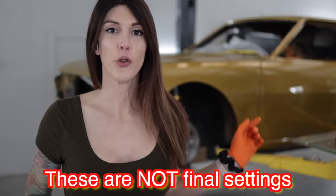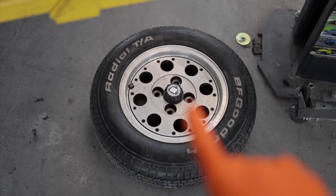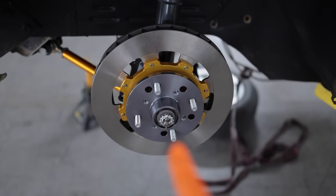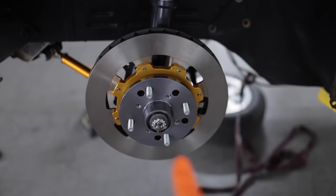The little stainless steel sleeve is for the outer tie rod with a ball joint — it just slips right through there. I haven't hooked up the steering linkage up top yet. This guy needs to be cut to length, since this is all custom up here where it attaches to the steering column. The issue is these are 300 millimeter rotors. I don't have tires on the new wheels yet — they're 13 inch wheels. 300 millimeter rotor, 13 inch wheel — there's no room for a caliper.